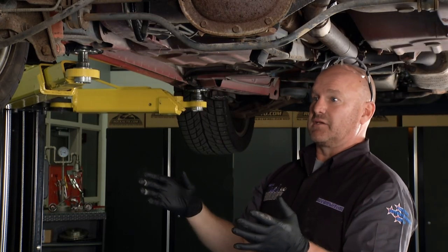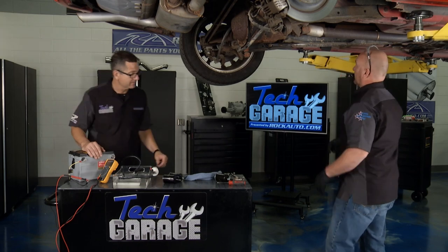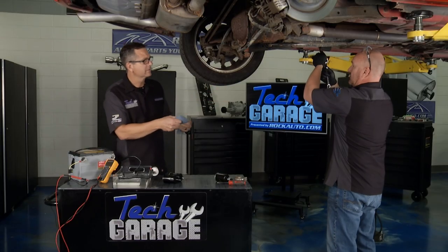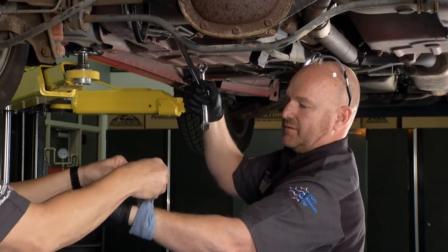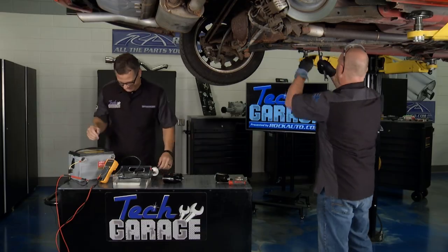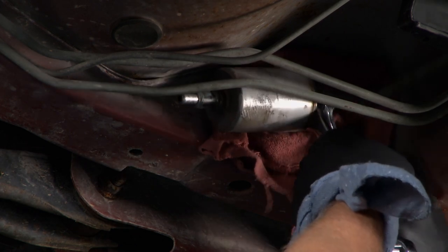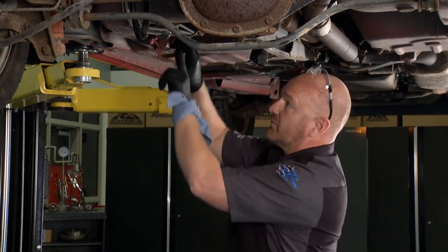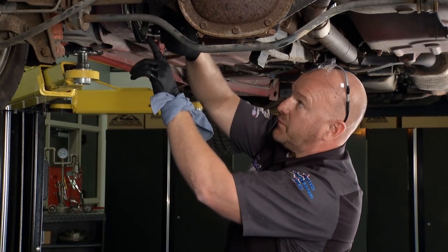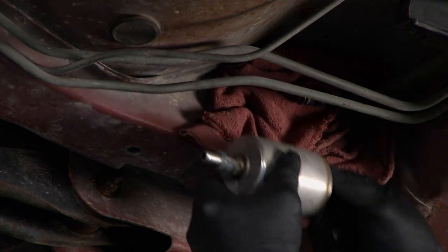On our Firebird, it's 75,000 miles old — a lot of wear and tear through that filter. Use a tubing wrench wherever you possibly can. Put a rag up in there before you crack the fitting — when that gas gets down in your armpit, you're going to thank me that's there. You've got to just crack these loose — it usually doesn't take much. I already have the back connector out. I was able to crimp it with my fingers and I've bent it up just to keep the dripping to a minimum. Back this out and we've got the old fuel filter right there.